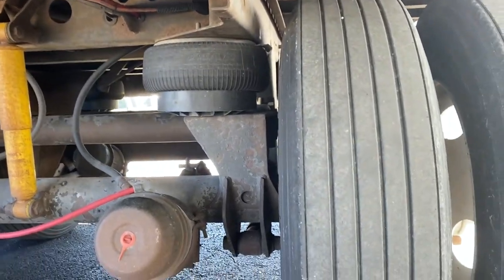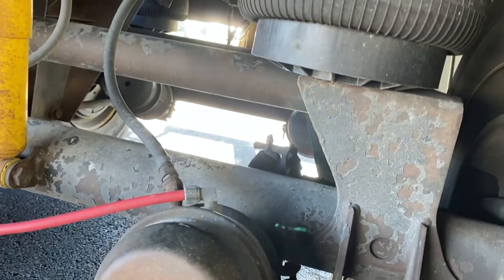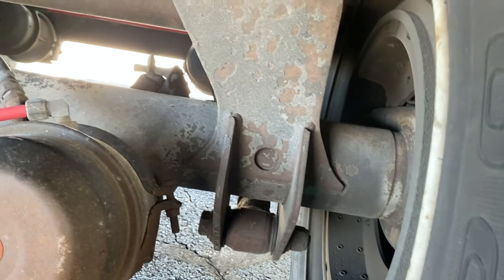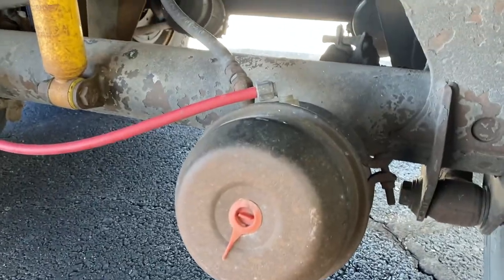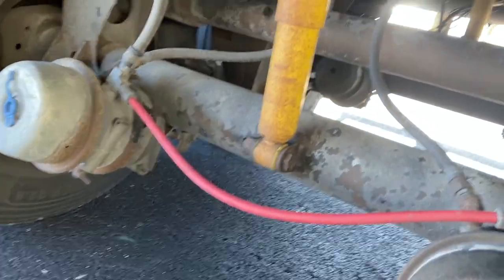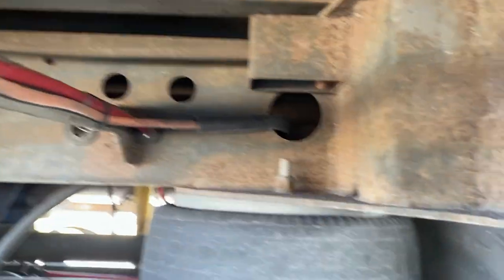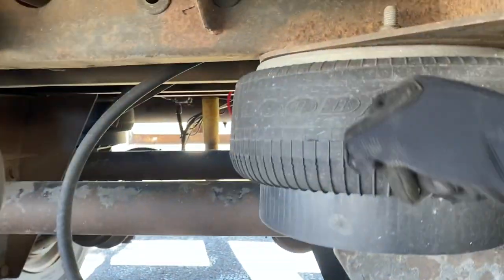Now we're getting to the rear tire system of the trailer. Start off with the suspension system — it might be a little different on the rear of the trailer; typically the rear of trailers is going to be air suspension. In my case I have shock absorbers — bolted securely, bolts on the top and bottom are not missing, no visible leaks on the shock absorber. Then the air bag is mounted securely with bolts on the top and the bottom, none are missing, condition of the air bag is not torn or damaged, no visible leaks on the air bag, properly inflated.